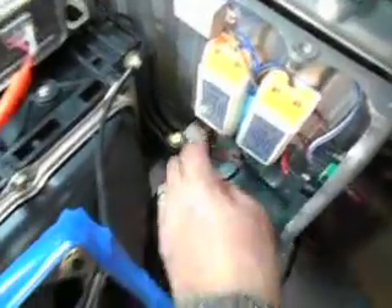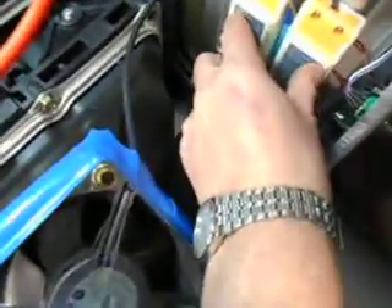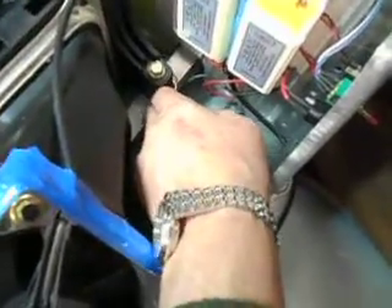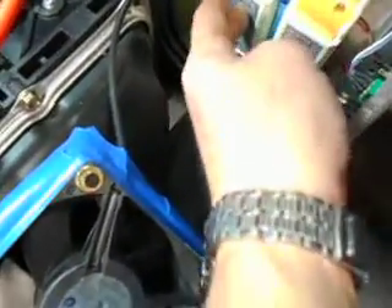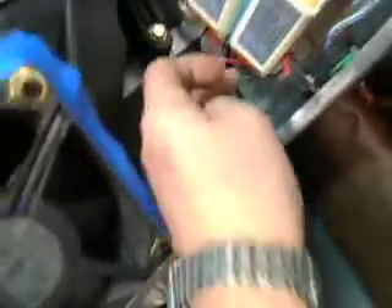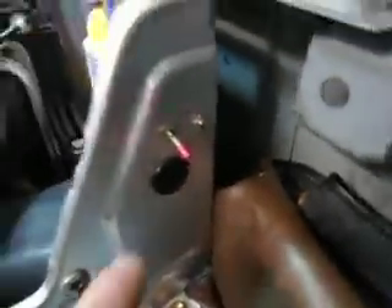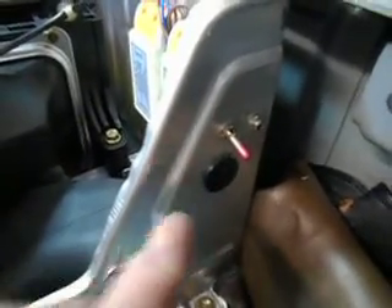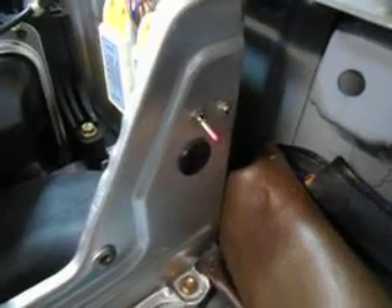No diodes at that end — they come here, and this car actually has the dump charger built in: a 12 volt LED driver and a 290 volt LED driver. There are some diodes in the wires here and they prevent the battery power being fed back into the chargers when the chargers are off. It also leads to a little socket here, so on the other side we have a grid charger or a load socket — this is where we can plug in the 300R resistive load.